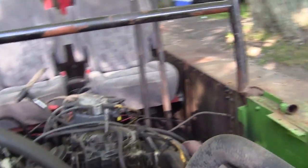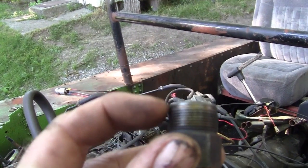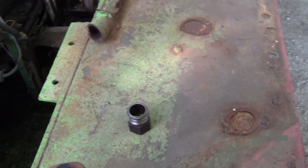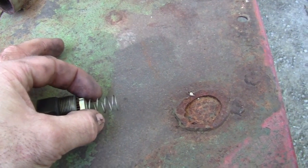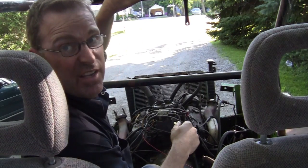I might add an inline one. I need to get this out of the way — there's too many people stopping on the highway trying to buy it. Another thing to note: this piece here screws on the block and it has a hard white plastic seal on the end — make sure that's there because if it's not it'll leak. The check valve goes inside like that, and make sure your spring is in there because that helps push the filter into the seal to seal it off so no gas can get by.